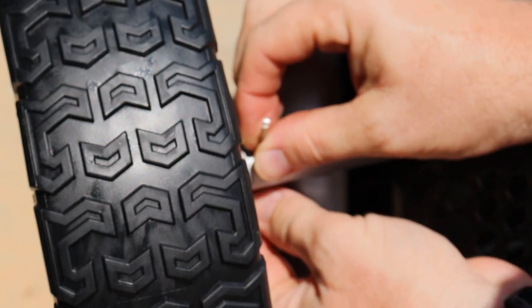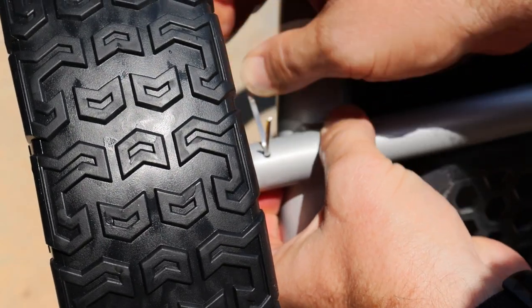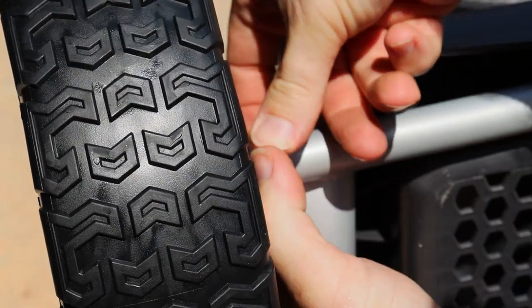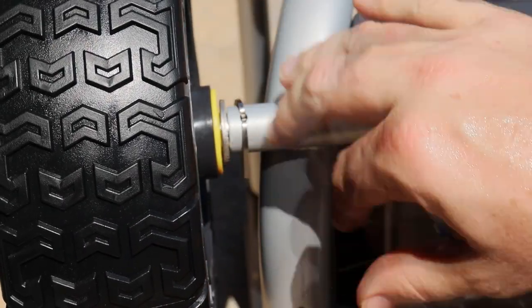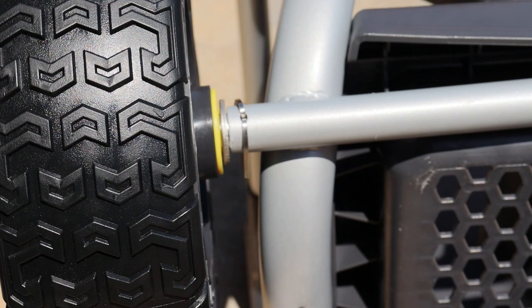I'll try to give you a view on how these wheels go on the axle. Remove the cap. Watch out when you pour out the blister pack so the washer doesn't go flying. Wheel goes on the axle first, then the washer — the washer has a rounded side and a flat side; put the rounded side against the wheel. Match up the holes. I'm rotating this so the long side of the cotter pin is facing up on the top side. These cotter pins are going to be exposed — I don't like that setup, but that's what we've got. Wheels are on.